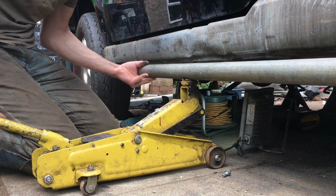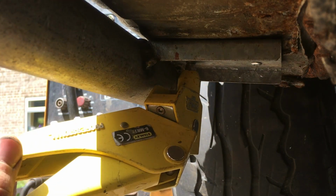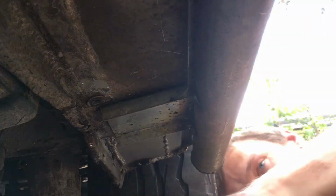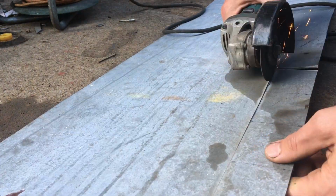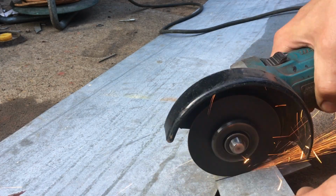So now it's back to the rock slider itself. Now we can rivet the front end in place permanently and work our way round to the back, but we're not going to leave it just to these brackets to do the job on their own. For even greater stiffness and strength, we're going to have another row of brackets, thankfully not on the underside this time. These will be vertical brackets riveted to the outside of the sills.